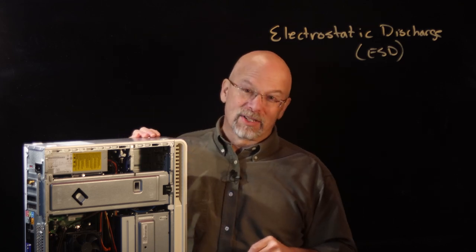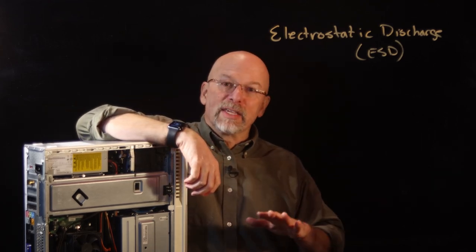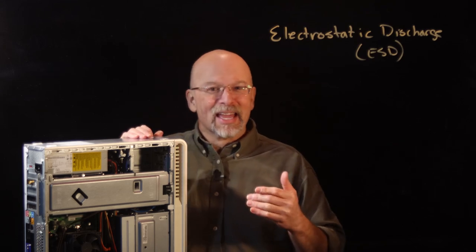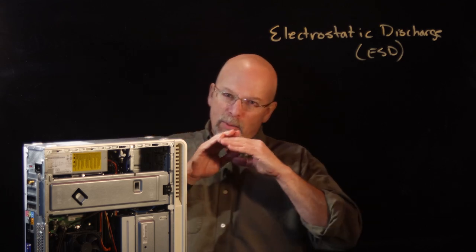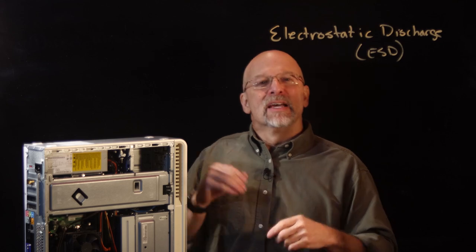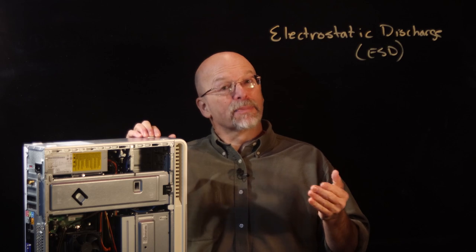It had started failing whenever there was an electrostatic discharge. What are some other preventative measures? Some include the use of mats — in my personal workshop I've got one of the electrostatic mats, and those mats are conductive. Don't think you can use a sheet of aluminum to work on — you don't want something that will short the devices. What you want is something that will draw away the excess voltage in a controlled manner, not an instant short circuit. If you were to measure the resistance between any two points on these anti-static mats, there's actually a resistance, so there's not a sudden immediate flow of electrons — it just draws the excess electrons away.